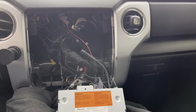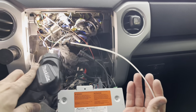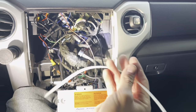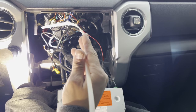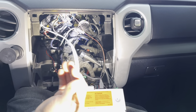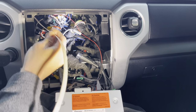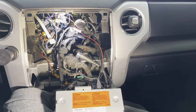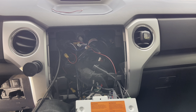Now we're going to feed the fish tape down through the dash. Look at this rat's nest — it has to be cleaned up, but I left it knowing I had to come back. There are a lot of wires in here — at least 200. Look for your gap; I can see my gap down there and I can see other wires coming up from there, which tells me I've run wires before. I can see my zip tie, so let me get it tied on and start pulling. Once the wire is pulled, make sure everything is nice and neat with nothing in the way.